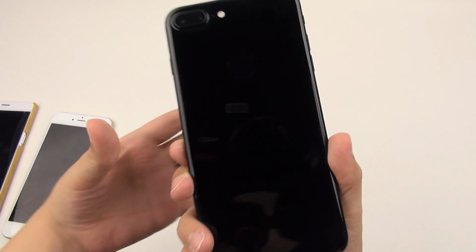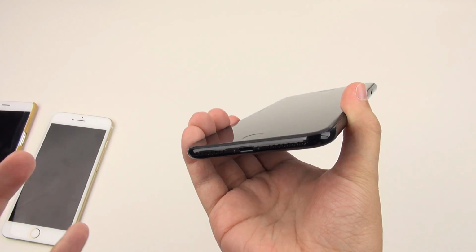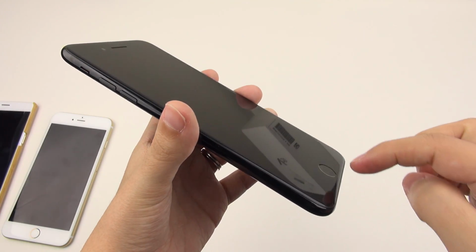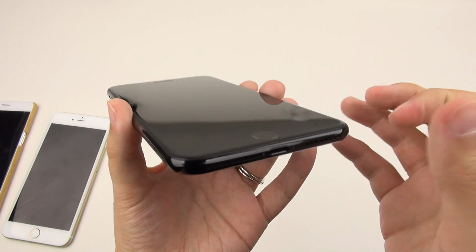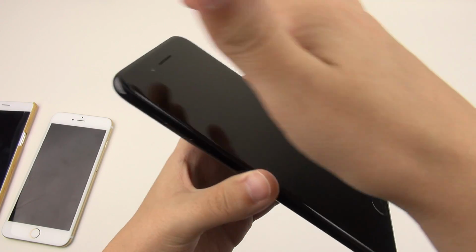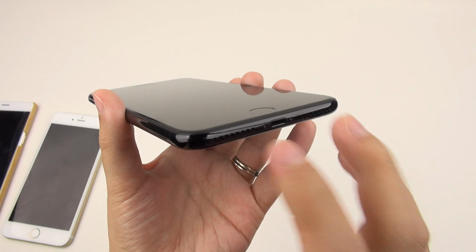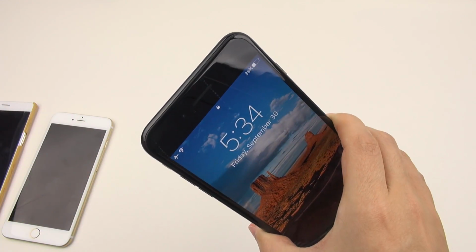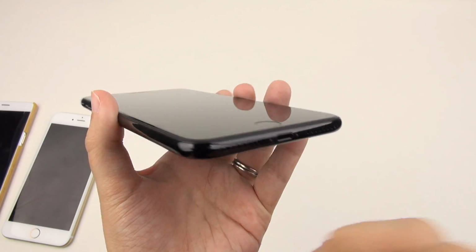I did have a chance to see Zach's video of Jerry Rig Everything, where he took the iPhone apart to explain what makes it water resistant, and I found that to be interesting. So basically you've got some double-sided adhesive sticky tape that's waterproof. The display is the biggest point of entry for water, so obviously they have to hold that down nice and tight and also seal that, so they did that. Then otherwise you have several other places such as the speakers, and those are protected with mesh that water can't go through unless it's under heavy water pressure. So that includes the earphone piece and also the speaker and microphone at the bottom.